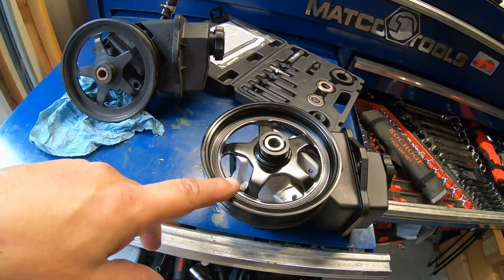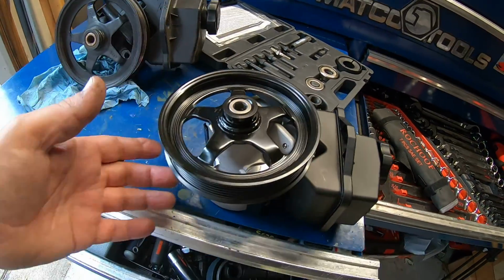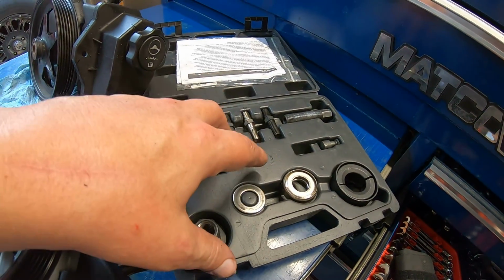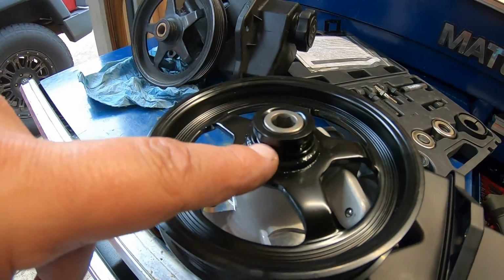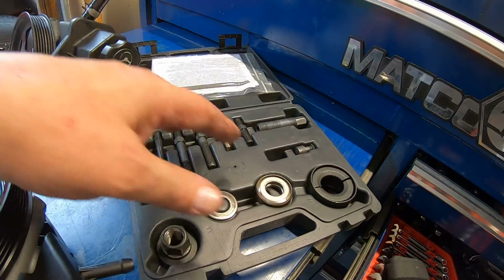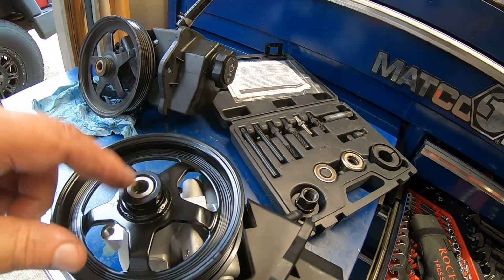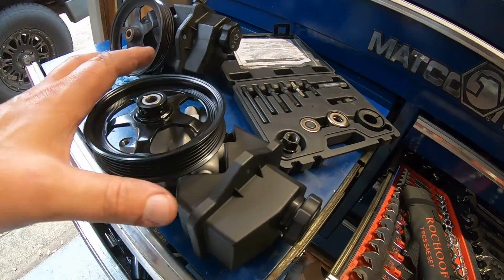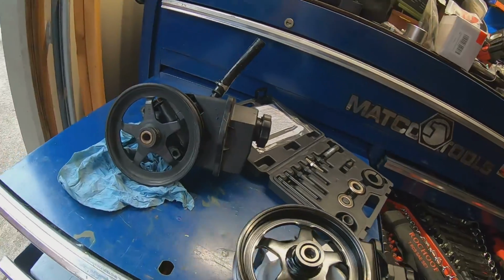So just in case you don't get a pump that already has the pulley and the reservoir, let's say you just get just the bare pump, you're going to need a power steering pump pulley remover and installer kit to be able to pull the pulley off and press the new one back on. I'll put a link to this kit in the description. They're not very expensive and it's impossible to do without it. So if you don't want to buy the kit, you're going to need to buy the whole assembly to be able to get this job done.